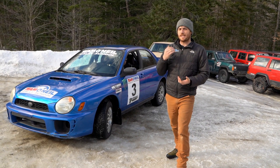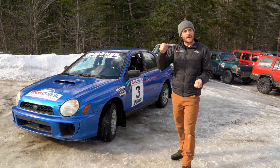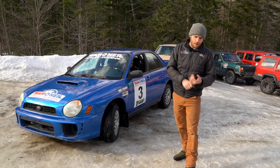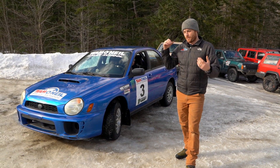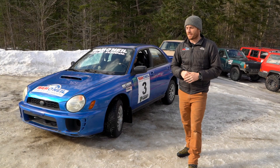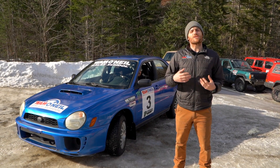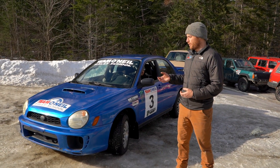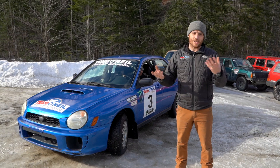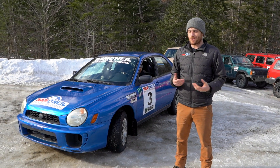That's about as good as you're going to get - three-wheel drive. You're not going to see a lot of limited slip front differentials in cars, really just so that the steering is nice and easy and you can go around tight corners. You will see it in some higher performance and race cars with limited slip front diffs. But as a production factory item on almost anything, you're not going to see it very often. These days it's easier to have open differentials and traction control, and you'll see a lot of companies market that heavily with different kinds of jargon like 'manumatic electronic differential aid' or whatever - just know it's an open differential with traction control.